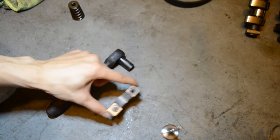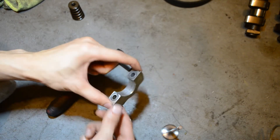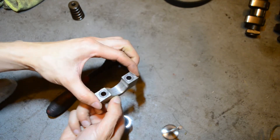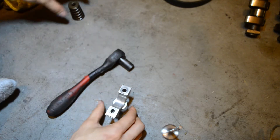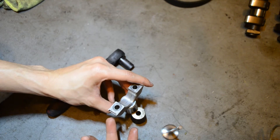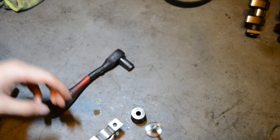In order for me to compress the spring, I don't have a compressor, and this is a temporary solution for me. I'm not telling you guys to do this method for all your valves — this is just a temporary thing because I didn't want to wait for a tool and I didn't want to buy a tool since I didn't have to take out all of my valves. So what you need is the 11mm socket with the ratchet and the older cylinder head camshaft cap. I'm going to flip it upside down and fit this 18mm socket, which is just long enough and big enough for me to compress two springs on each side at the same time, allowing me to take out two valves at once, which is actually really easy.